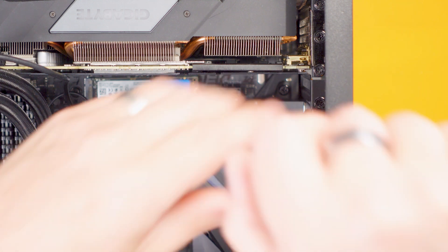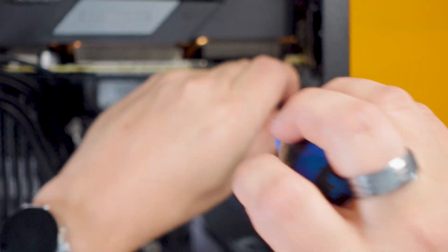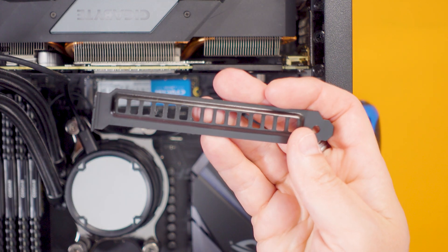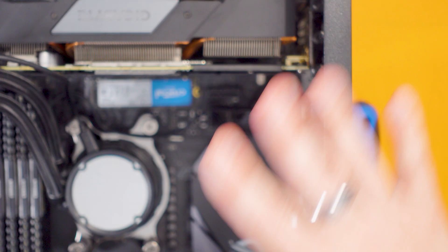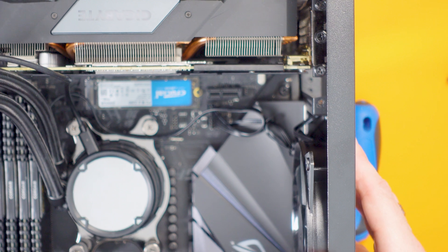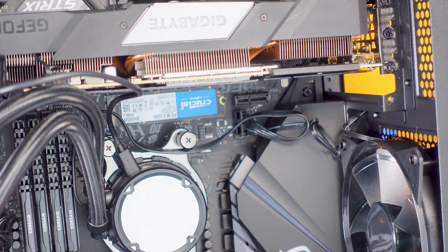So we've established I've got a spare slot — let's fill that slot. I've just got to unscrew this screw here to remove the blanking plate. Now your computer might not have them screwed in; it might mean you have to bend the metal and jiggle it a bit to get it to come out — it really depends on your case. Most gaming cases like this do have these slots that you just unscrew and pop out. But if you've got an older case, you might have to wiggle it from side to side and slowly break it free from its metal tabs. Be gentle — not too gentle, but gentle enough. So now we've got our slot and a nice hole in the case for the stuff to come out the back.